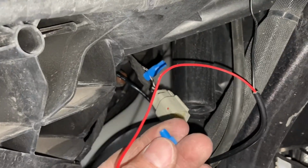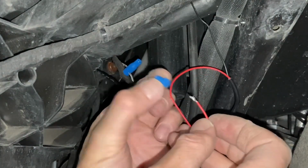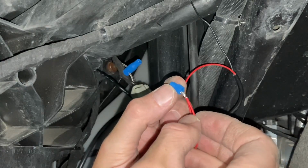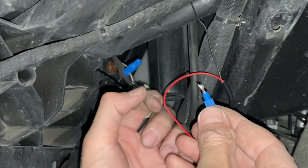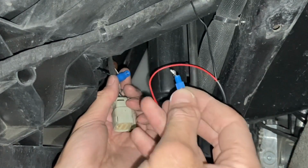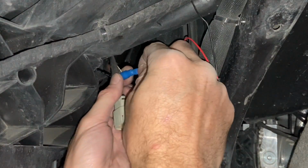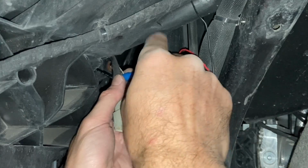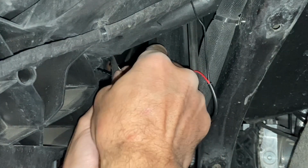So now we can take our red and actually connect it to the back using this little piece of the end, which we took off. So we're gonna feed the red wire through the back side here. You're going to see all those little exposed ends. Make sure they all go through. Right now it's sticking out and it's kind of looking a little frayed. You want all of those little ends of that wire to go into the backside here of this raw metal, touching it. Now we're going to screw this in, and this is going to clamp down the wire.